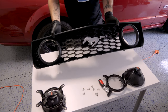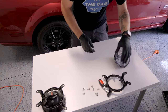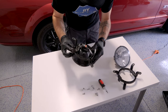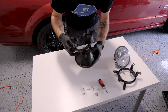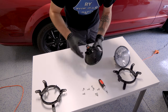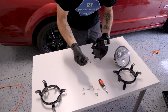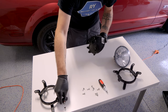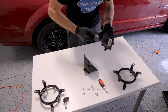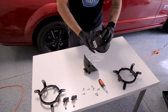When that's done, just set it aside and take this opportunity to clean it of course. This wasn't supposed to come out so easily, but it looks like they're just pressure-fitted — if you push on it, it does pop right off nice and easy. I took that bracket off for ease of use. I'm also going to remove the actual bulbs only because they're kind of fragile — you don't really want to be jostling them around, so I'll gently set those aside. And now we have just our regular lens for our lights.